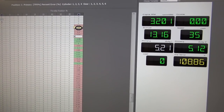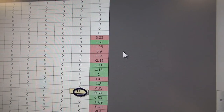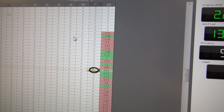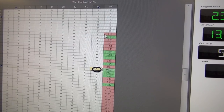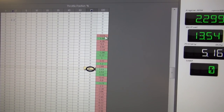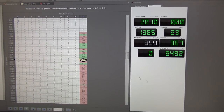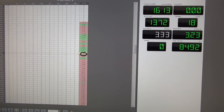All right, look at that — it's gone in and got these cells mapped. We're getting pretty good here but still a little off. Generally it'll take about three to four runs to map an entire column — it depends on the bike. These dual injector bikes with a primary and a secondary injector are a little bit more trouble and require a little bit of hand mapping, but we'll get to that in a second.